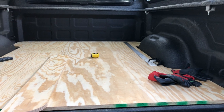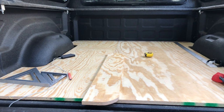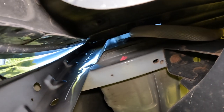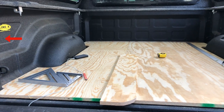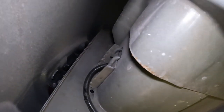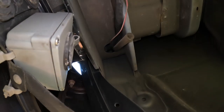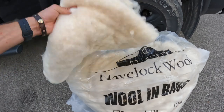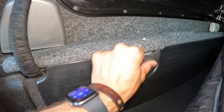When designing my camper build, I did not want to make any penetrations into the truck body. So I removed the large plugs at the front of the truck bed and ran my drain lines out the holes. I then sealed around them using waterproof Gorilla tape. I used the holes located at the left and right rear of the bed close to the tailgate for running an electrical cord and the air vent for my fresh water tank. Any remaining holes I sealed up as well. Once sealed, I lined the inside of the camper walls with a layer of Havelock wool insulation and placed rubber seals around any openings.